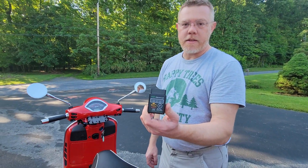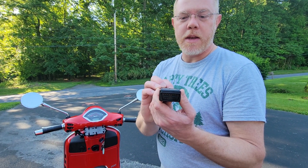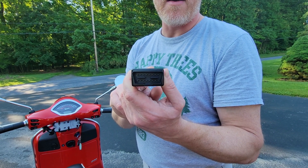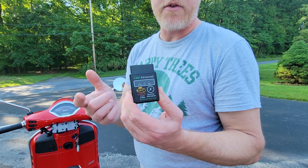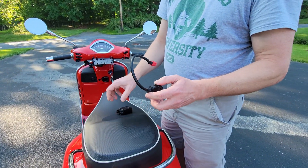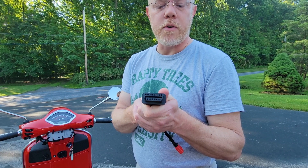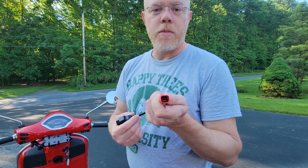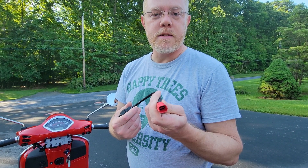The adapter is a standard onboard diagnostics adapter with the 16-pin connector. This one happens to have both Bluetooth and Wi-Fi. You can use a standard handheld tool — you don't have to use the Android interface, but this is what I've got and what I've been using. In order to get between the 16-pin connector, the standard OBD-2 for automobiles, and what is on the Piaggio products — both Moto Guzzi and Vespa — there's a 6-pin connector.